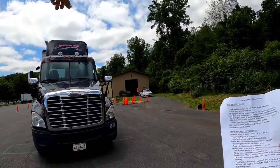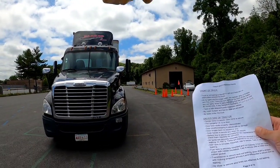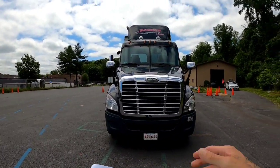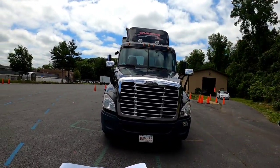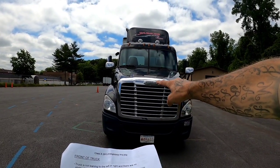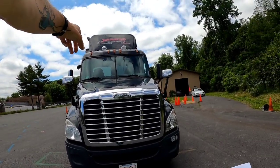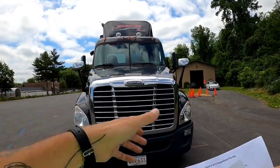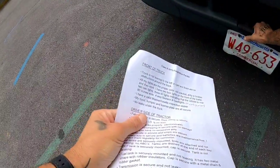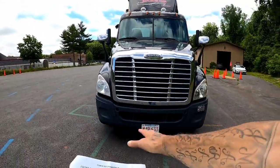I have 2 box lights located at the top of the trailer, 2 cab lights, the 3 ID lights in the center indicating that the vehicle is over 80 inches wide, 4-way flashers and headlights. Have a valid Massachusetts inspection sticker. My hood, bumper, and license plate are all secure. There are no leaks under the truck.